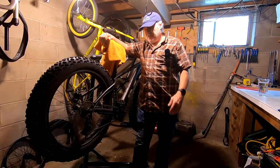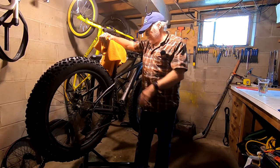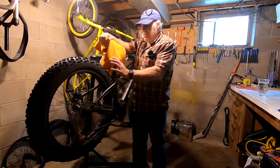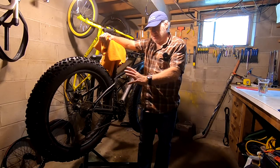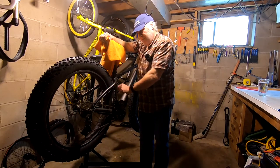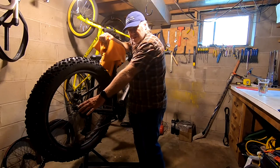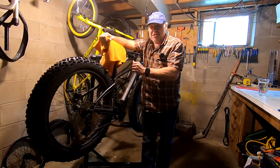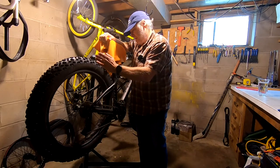Hello, welcome to my channel. Today I'm going to do some upgrades to my fat bike — I touched upon it in a previous video. Primarily I'm just going to update it to a 1x10 drivetrain. Right now it's 2x10 and the rear cassette doesn't quite have the range that I need for going 1x10 in the snow.